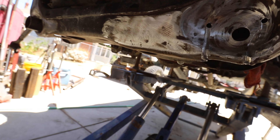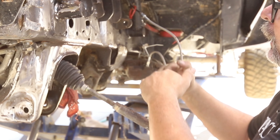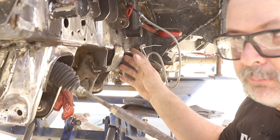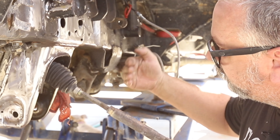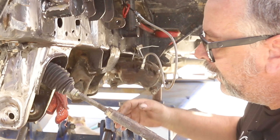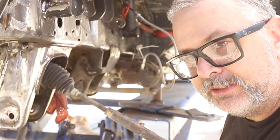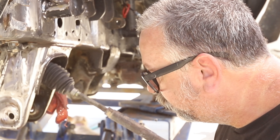What's happened is you're starting to see cracks appear in the lower pivots. In my opinion, that's a result of not actually having a bump stop. What happens is this lower arm comes up and it bottoms out through the shocks because there is no bump stop — it's using the shocks as a bump stop. That puts leverage right here on that arm, and when it comes to a stop it forces those bolts down and ends up cracking these pivots.